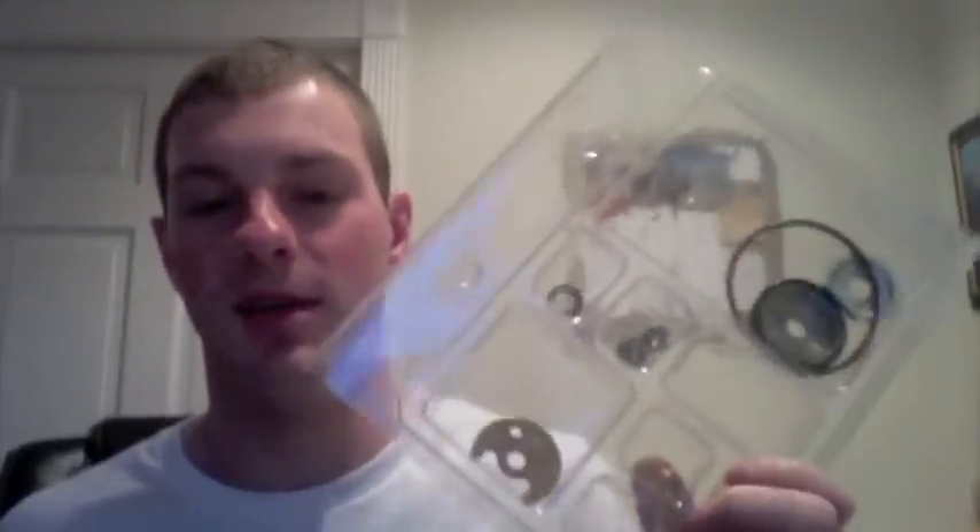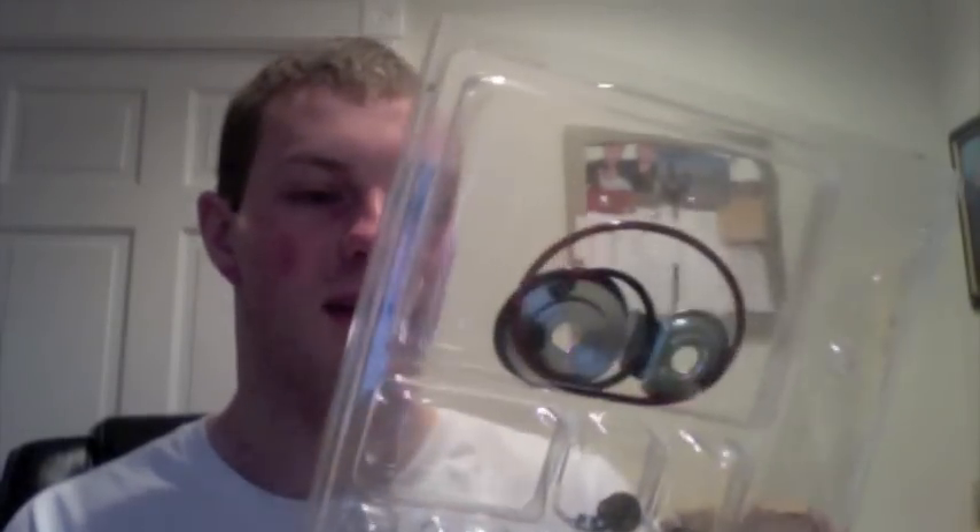At the bottom of this video I'll post a link to where you can buy this kit. This really is the best kit you can get if you're looking to go with an upgraded turbo, or if you just want the extra durability of having the two oil ports and the thicker thrust collar and thrust spacer. The width of the new thrust collar and thrust spacer is now 14mm wide, rather than the original 10mm or so from the factory. Please take advantage of this good deal.